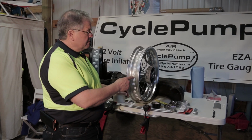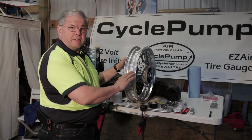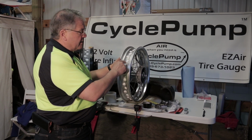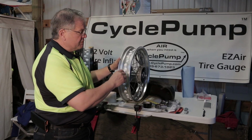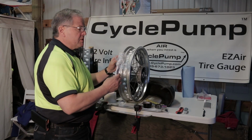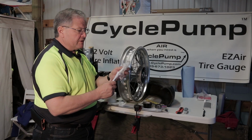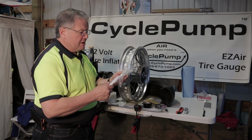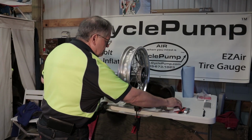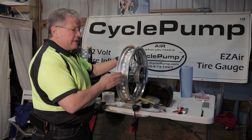Here we are the next morning, inspecting the work that we did yesterday afternoon. We were able to get all of the sealant onto all of the spokes last night, and we've gone along and added a little bit here and there where we had a small void. We've trimmed off any high spots, and one thing I should mention is if you're going to be separating the time periods between the spreading of the sealant, if you just take a piece of saran wrap and use that as the cap, that will keep it fresh until the next morning. A lot of guys will say, well, this is enough, I can ride this way, yahoo. We like to pad our chances.